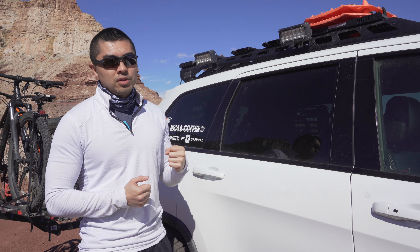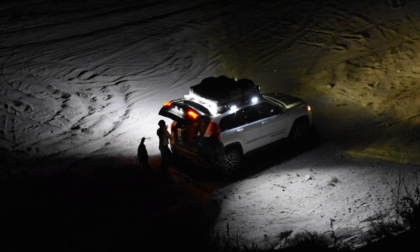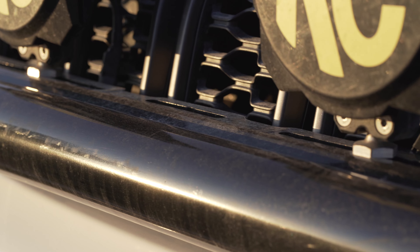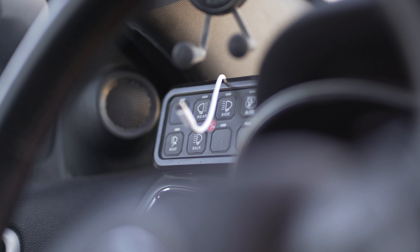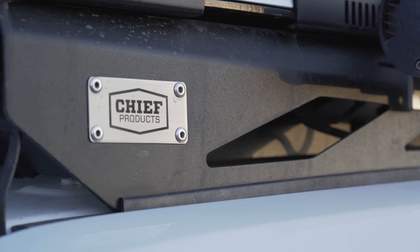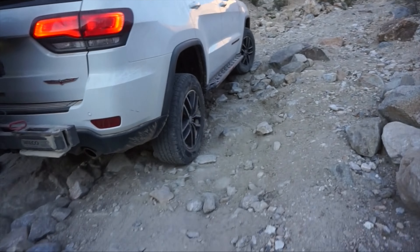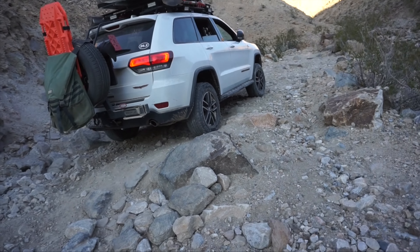One of the other accessories I really wanted to mount on the new rack was my lights. I had this vision to have 360-degree lights on the roof. I've since changed that because I found that forward-facing roof lights tend to be a little bit unusable, especially in weather, so I've decided to push those down towards the bumper. The lights are wired to a switch on the inside with a secondary battery in the trunk. All I had to do was run the cable through the mounting channel — there are specific holes for the cables — and then insert the T-nut kit and put in a bolt for the L-bracket.